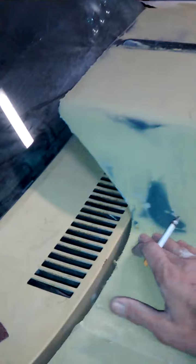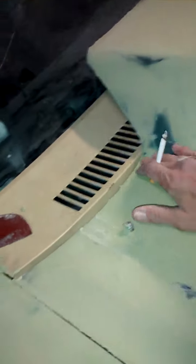Hey YouTubers, it's RV camper living Edward Martin. Just wanted to show some progress on this Nova hood. This is my fourth video. I put a round bar through the hood all the way across to the other side, fiberglassed it in. These sides were bent down, it made the hood look like it laid down at an angle all the way in and up. So that's reshaped — looking back across it, I re-fiberglassed the hood all the way around.